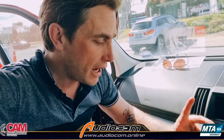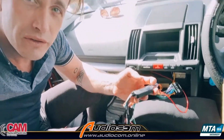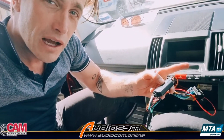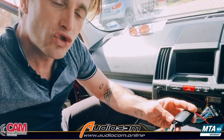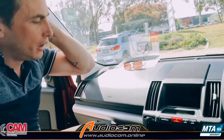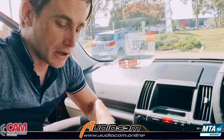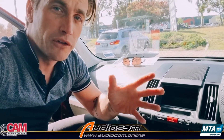That all linked up fine, however, because there are a lot of data platforms and it's not unfortunately a perfect world, sometimes the data that this reads from the car side isn't quite right to trigger the head unit and get it to switch on and off with the key. This vehicle, and a lot of late model and European vehicles, don't have a traditional switch on/off accessories — it's a data feed that comes from the body control module of the car to tell the head unit via a data pulse to turn on and off.